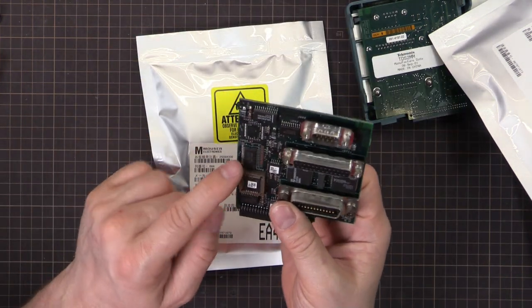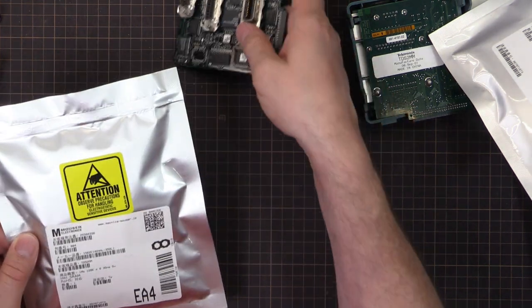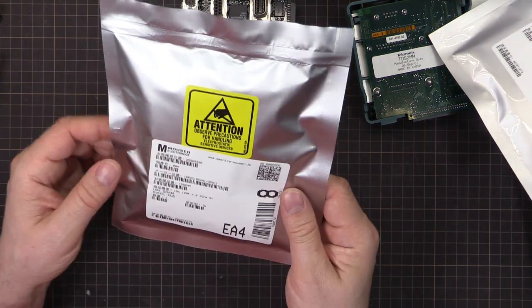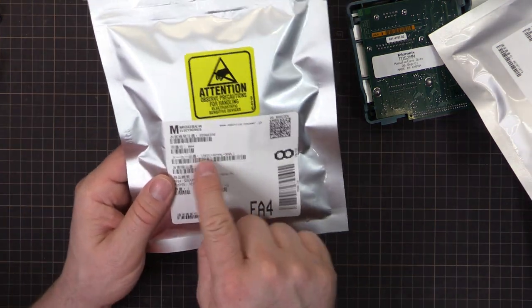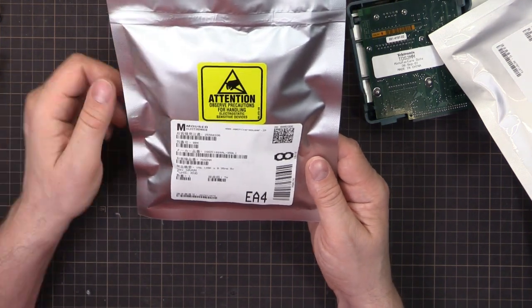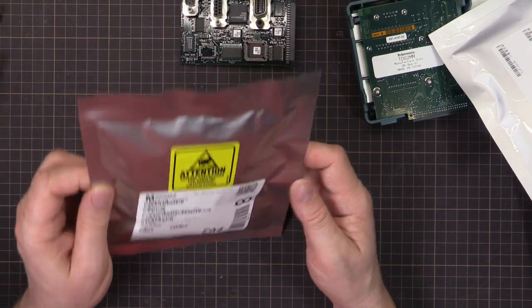So it looks like they've got a dual footprint. But you can figure that out if you're getting another chip. Make sure it's the same package. So if you look up this part number, which I've already put up on the screen, and it'll be down in the list below, you can cross-reference that to another chip that's available locally.